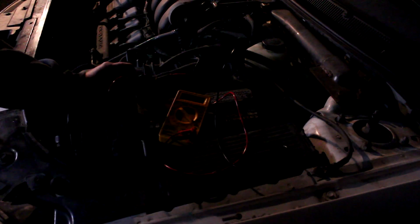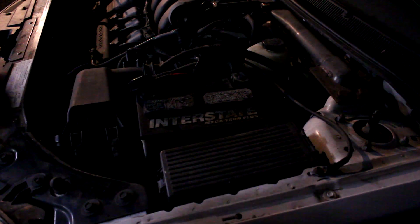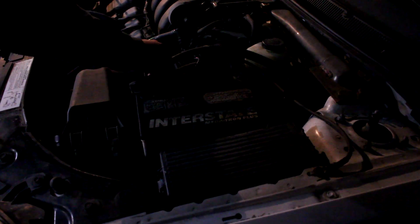Now let's check the battery with the car off. We're actually getting more power right now — 12.0, 12.1 — and it's recovering, going up. So it looks like the battery isn't getting any power from the alternator. Let's make some obvious checks first and make sure these cables are on tight — they are.